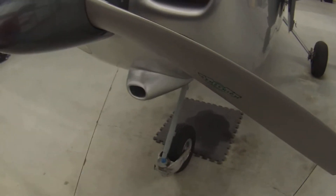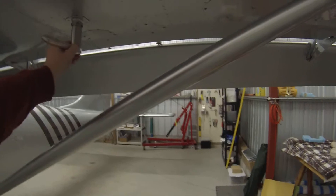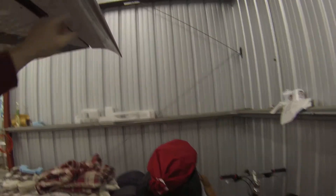Generally looking at the condition of the nose gear, that the bolt looks in place properly and nothing looks out of place, nothing's rubbing. Again look at the cowling on the pilot side, the static port looks good, nothing in the vent. The inboard vortex generator also looks good. Check the security of the pitot tube — everything looks good there. Work my way up the leading edge of the wing on this side; the outboard vortex generator looks good, and the vent for this side of the fuel system. Check the lights on the wing tip and all of the fasteners for the wing tip fairing.